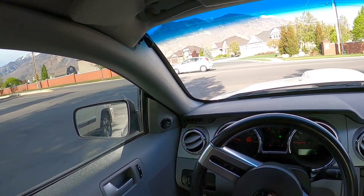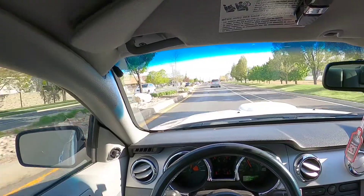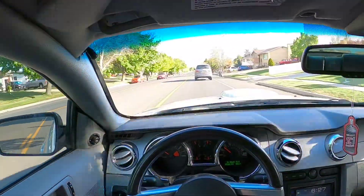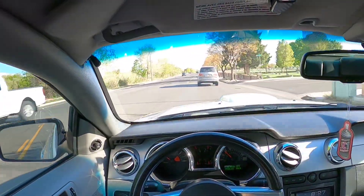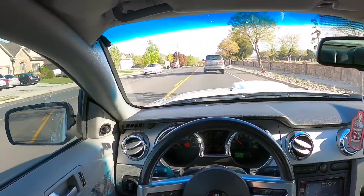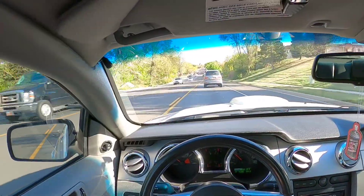This lady probably thinks I'm crazy wearing a GoPro on my head. Overall, it made it feel a whole lot more stable — even just normal driving it feels not as much like an old car, even though it is pretty old. It is a little stiffer so you feel a little bit more, but that's a combination of my car being lowered and these new lower control arms with the stiffer bushings and ball joints. It's hard to say compared to a new stock set of ball joints or control arms since mine were pretty worn out.